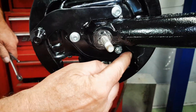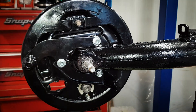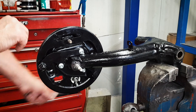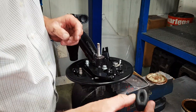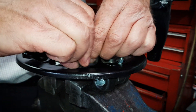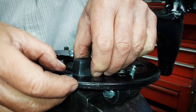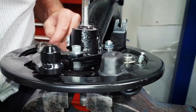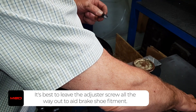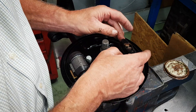So now you'll see we've got the bracket on for the handbrake cable and the bracket that holds the anti-roll bar. We'll show you the anti-roll bar fitting when we've fitted the actual radius arms to the car. Next we're going to spin it round, put the brake shoes in, and put the rear drum on. We'll just pop the little gator on — the one for the handbrake mechanism to come through. It's a little bit awkward to get on. First job is to pop the adjustable quadrants back in with a little bit of copper slip on them before putting them in — not too much, because if it gets hot it'll run out. Just enough to stop them seizing.